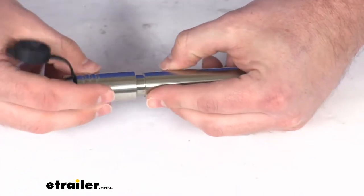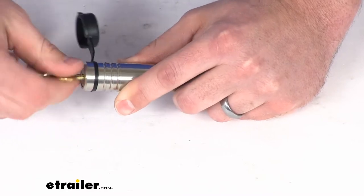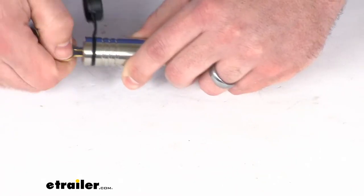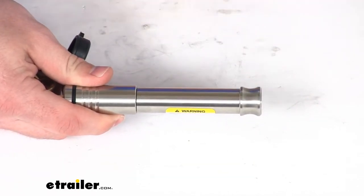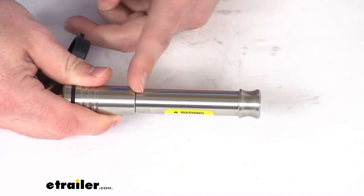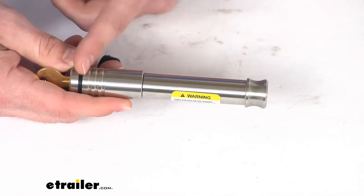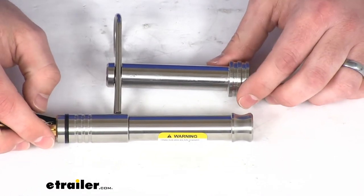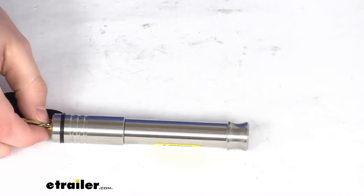This pin is a three-quarter inch diameter, so it is going to be exactly the same as the original that you are replacing. Our inside pin length, or our span where we're going to have this connected to our ball mount, is right at two and seven-eighths of an inch. Our overall length is about five and a half inches, so when you compare that to our original pin, you can see it is going to stick out about an inch and a half farther — so make sure that's not going to cause any problems for you as far as clearance.